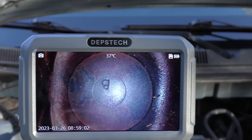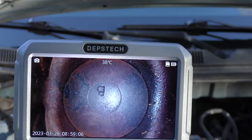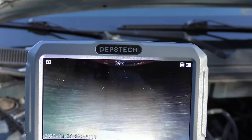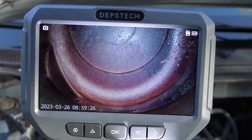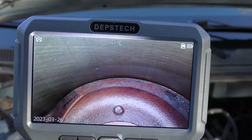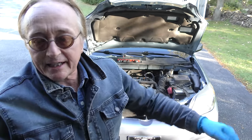We simply put it in the spark plug hole and look around — you get a really clear picture inside. When you turn the knob, you can look inside the cylinder wall all around. See how it's all smooth? You can really get a good view of what's going on inside the engine. Now this is my Toyota Matrix — it burns zero oil, gets 37 miles a gallon on the highway, runs perfectly fine. I didn't expect to see anything wrong; it would have shocked me if I did.